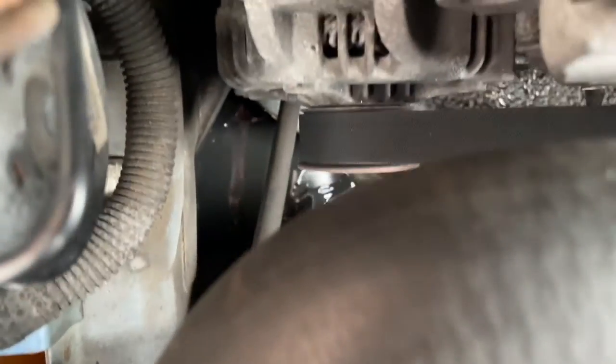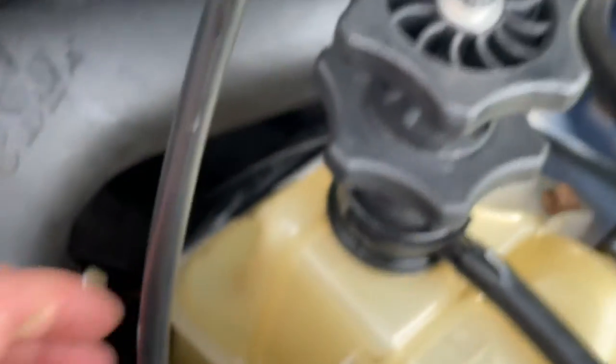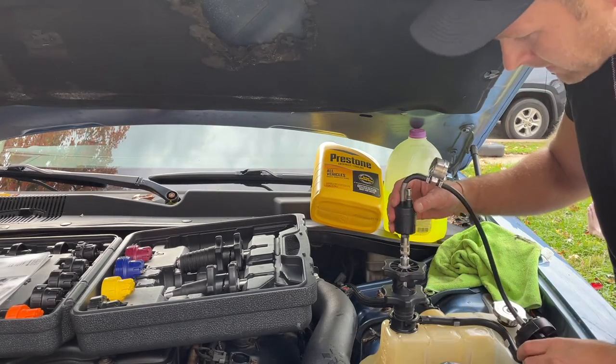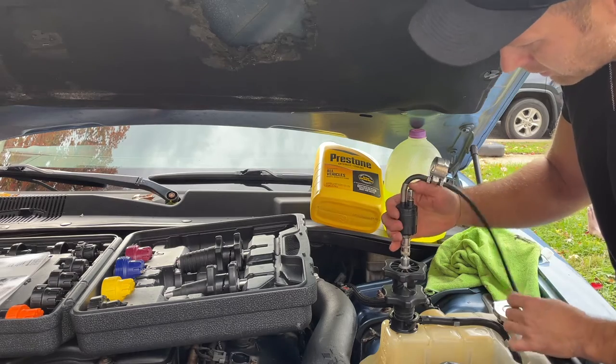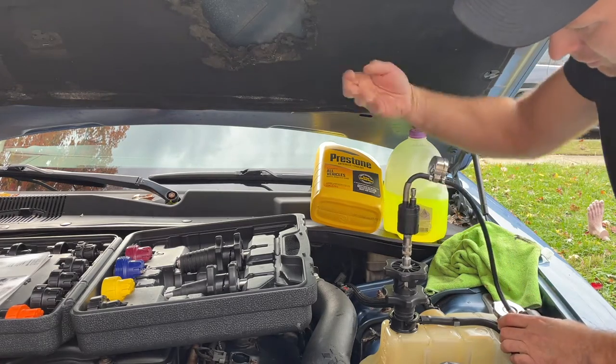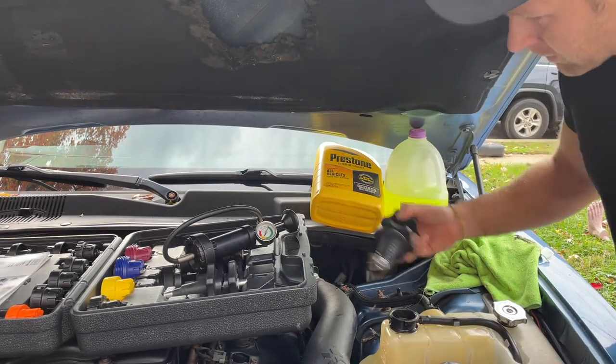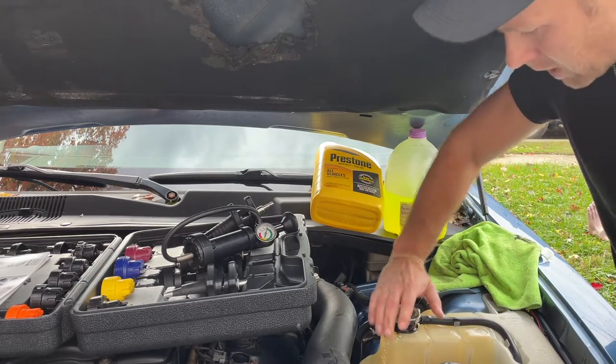This was actually easier than I thought. I thought I was going to have to mess with the thermostat and everything, but the leak is right down there. You can see where the hose is connected to the radiator — I'm going to have to dig in there deeper, but it looks like it's the radiator, plain and simple. So it's going to be another project, another video for you guys. The pressure was at 12 and it's already dropped to 9 — we've got a leak confirmed. Now I'll show you how to disconnect. There is a pressure release valve here — give this a push and it releases all the pressure so you can safely disconnect it and nothing jumps out on you. Then we use the quick release and twist the adapter back out. This is disconnected. I'm closing this off — I'm not going to refill it because I've got to replace the radiator.